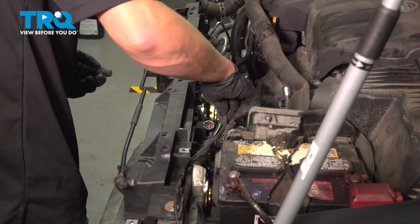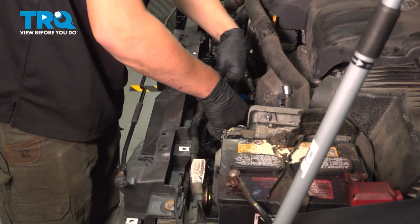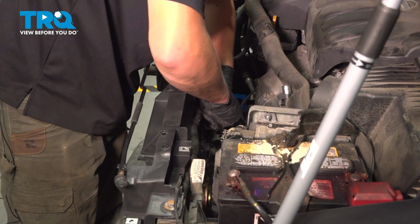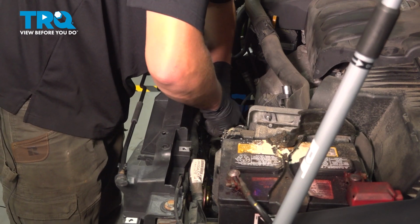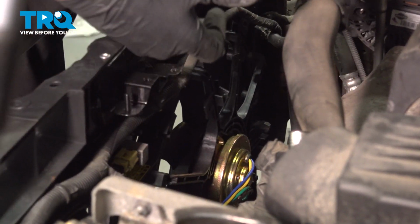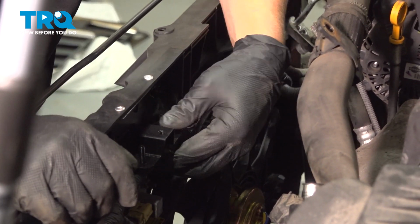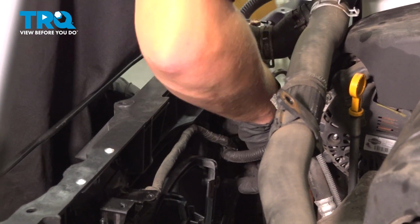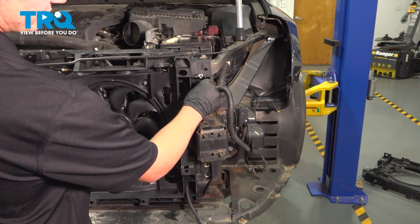Make sure your hood cable goes through the hole in the front. Second fan connector. Sensor under the hood prop. Once you push this yellow connector on far enough, it will spring load forward and click in. Keep going down the line, installing your push clips. Install the rest of the radiator support bolts.